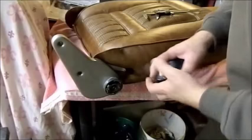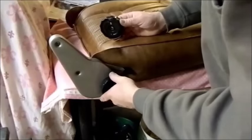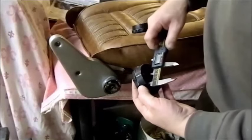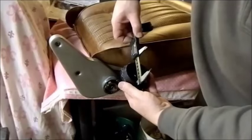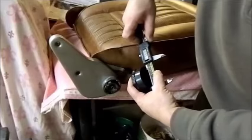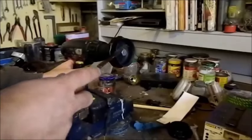I'm having a bit of trouble — the old reclining knob works really well but the new one is locking up. This is why I don't throw old parts out until I'm really finished with them. The old one has 60.2mm clearance where this one has 59.2mm — so the reproduction ones are a millimetre too small on the inside.